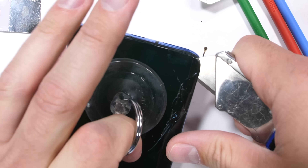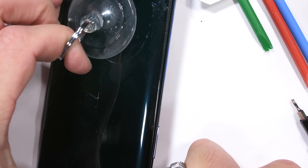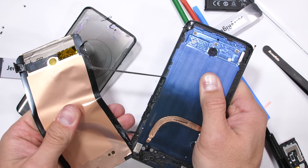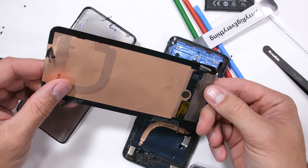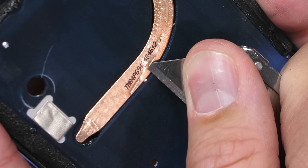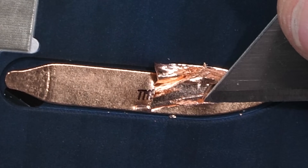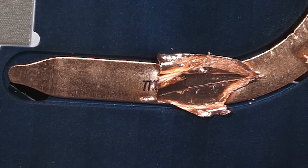The screen of the OnePlus 7 Pro is impressive all by itself — with a 90Hz refresh rate, it rivals even the gaming phones on the market right now. When I finally get the screen separated from the phone body, it's interesting to note that the AMOLED layer is not glued to the underside of the glass like we've seen previously on smartphones. It's a separate unit and is extremely flexible, kind of like paper. But we do finally get a glimpse of the rest of the heat pipe with its subtle curve horizontally across the phone body. Cutting it open reveals the copper threads that wick moisture from one end of the pipe to the other. I don't see any evaporation, but with the super small amounts of vapor inside these pipes it probably disappeared pretty quickly. It is super clean inside, unlike the dirty pipes inside Samsung and LG.